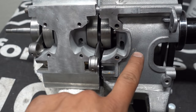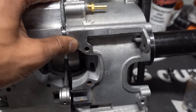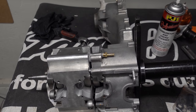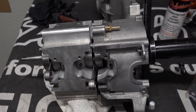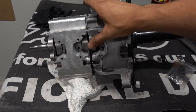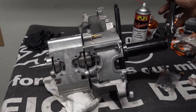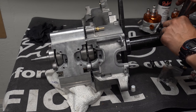My center section is one unit, so I'm just pulling it in. Get it all set up with Honda bond, make sure the dowels are squared up and everything matches. Prep is everything — it's taken me a long time to learn how to take my time and prep properly. Clean, clean, clean — brake cleaner is great because it evaporates really fast. I like using a wrench because I can feel what the motor and crank are doing.